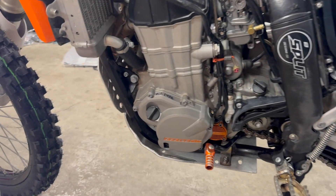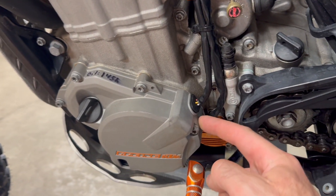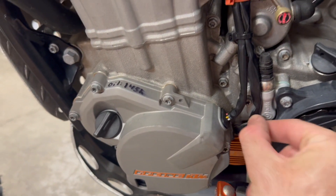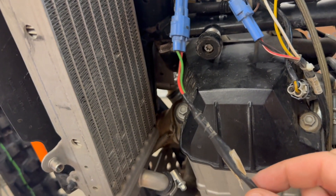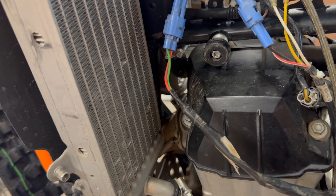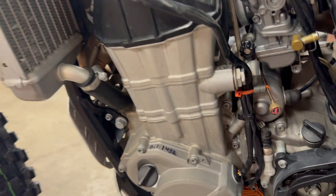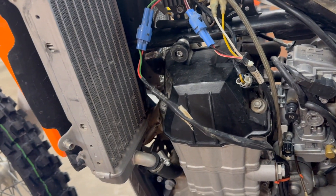The first step is to identify the wires coming out of the alternator or stator cover. There are two bundles. The bottom one has two wires in it and makes its way up along the engine to a single connector with red and green wires. This is the crank position sensor, also called the ignition pulse sensor or crank pulse sensor. It basically lets the computer know where the engine is in its cycle so it knows when to fire the ignition.